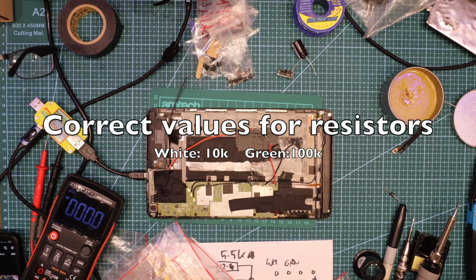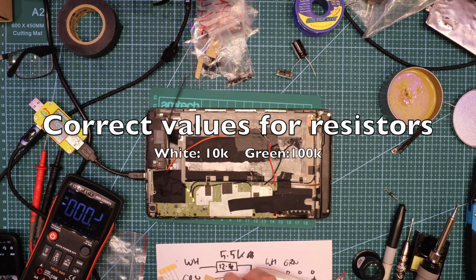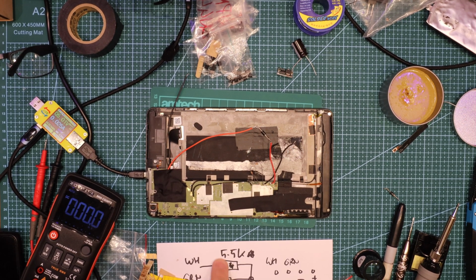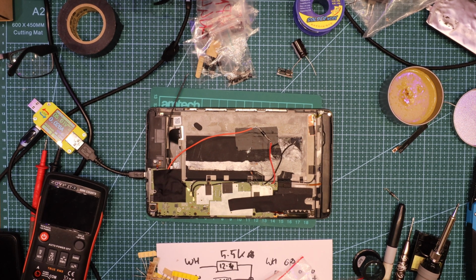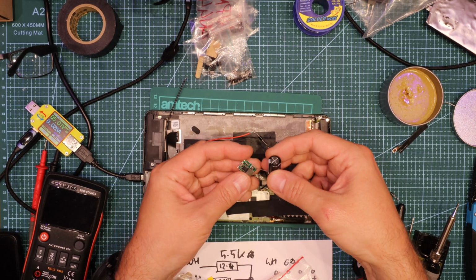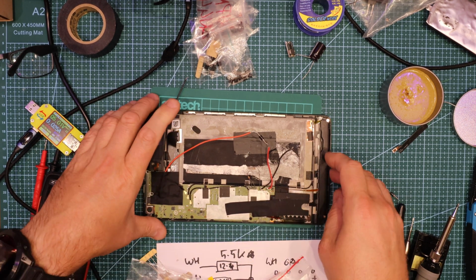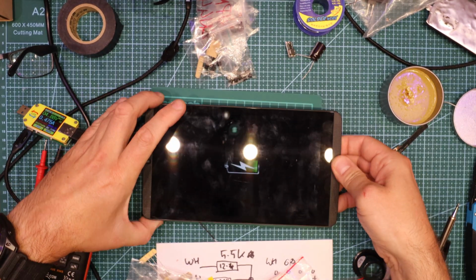After a short break and trying so many resistors, well, not all of them, some of them, what I figured out is I have to only use 2 resistors: 100 kilo ohms instead of that 126, and 10 kilo ohms instead of that 12.4. This circuit is working. And what I also noticed, I bypassed the mini controller. I just put one single diode between plus coming from the USB and the plus battery, and what I got now is this.